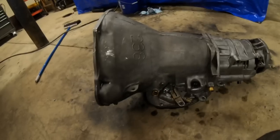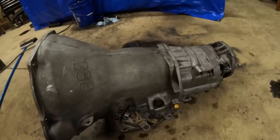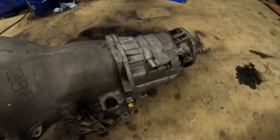Yeah, basically the only thing we really did to it was we changed the clutches in the direct and forward drum. The overdrive literally has maybe 4 to 5 passes on it, and we don't have a good press here to take that apart, so we didn't mess with rebuilding the overdrive. All the material that came out of this was just brown. There was not a lot of metal shavings or anything like that, so we just kind of cleaned everything up